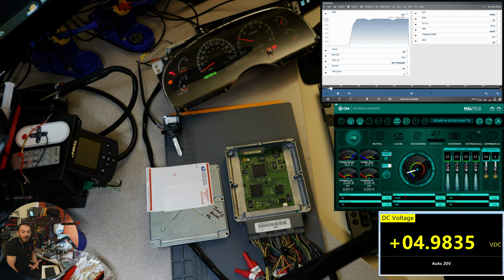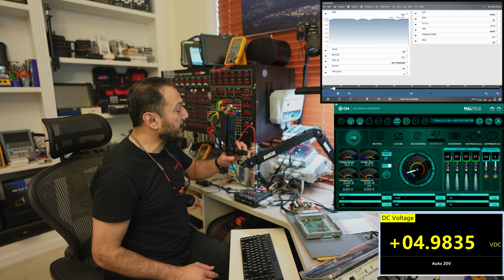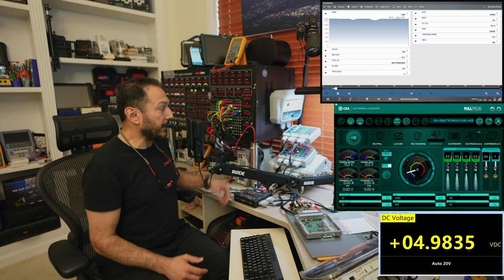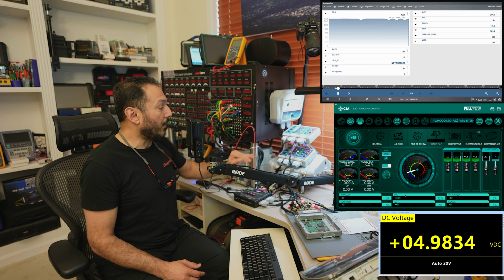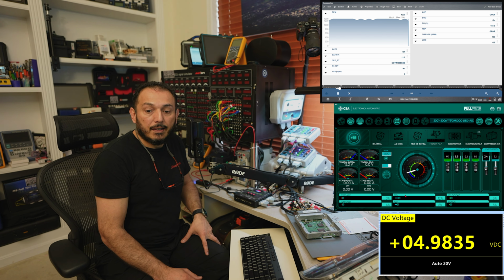This is what I like about having the fuel probe like this, because sometimes it's a little hard, even if I change the camera view. I move you guys to here. Myself, I can probably put that in there like that. Myself, I can see everything. And if I bring this up, you will see the other lights blinking in there. I have the 8 coils and the 8 injectors all connected and firing in order, completely correct to this computer. So everything is working 100%. So this is no doubt the computer is fully repaired.